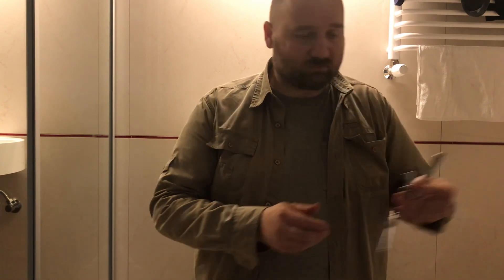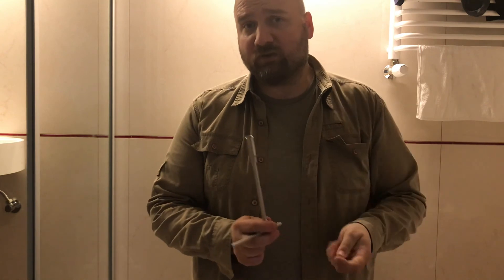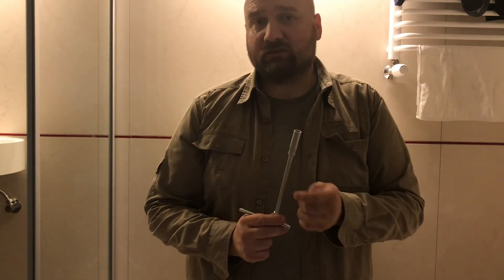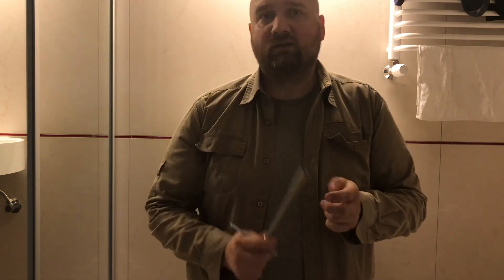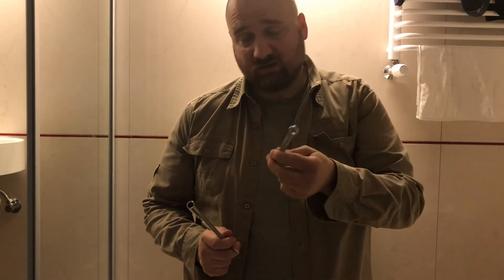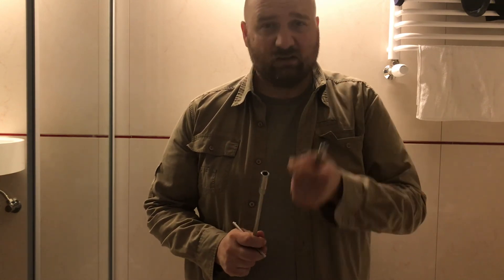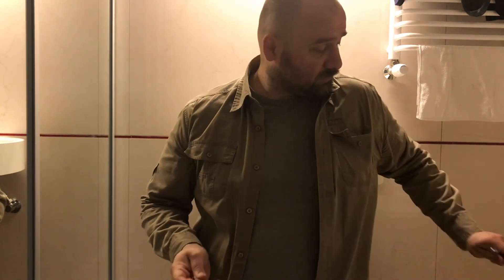For that purpose it's quite useful to get these extended long sockets, because as you probably know the mounting is usually this metal semicircular piece and then you have this long threaded pin. With a regular socket you wouldn't reach to the nut, and with a key you'd be moving it around 50,000 times — quite a tedious job. With this it'll be quite quick and easy.